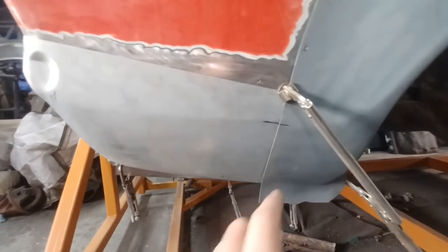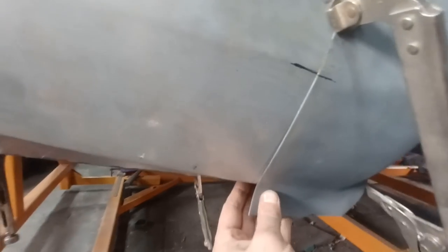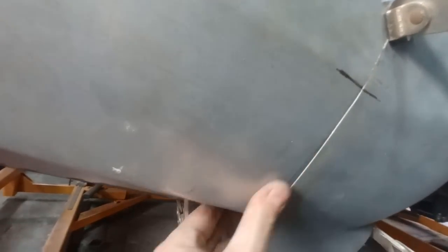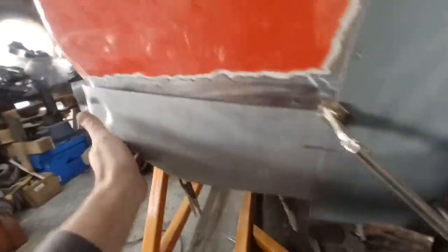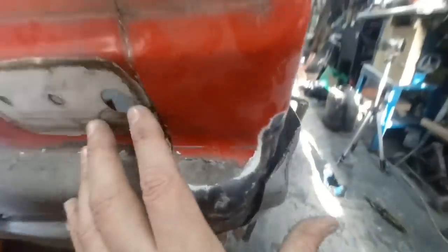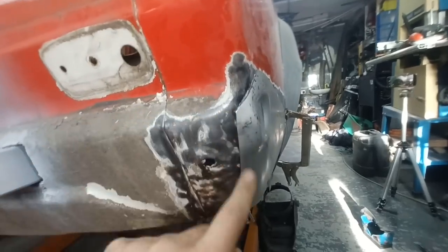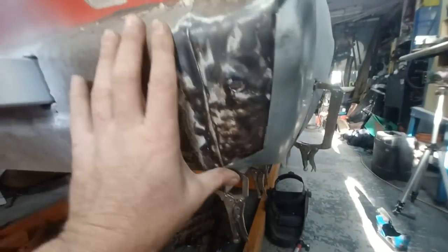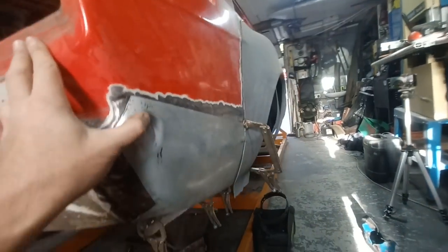Righto, that's something we can work with. So we've got our swage lines lining up there now, and this will tuck nicely onto that panel there. I've left enough of this panel long so we can join these together in there, and this at the back end here now, it'll come in and I can work that and cut and shape it if I have to, to get that to line up the back of the car. So that's starting to take quite a nice shape there now.